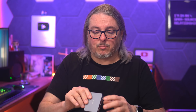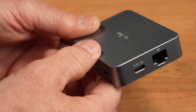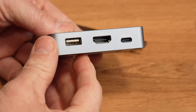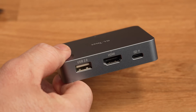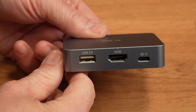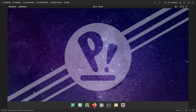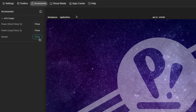Back to this little device. I wish it were PoE — it's not. That's the one spot I think they missed, but in the sub-$100 category it's hard to find any that are PoE. We do have standard USB power, one standard RJ45 connector, HDMI in, a dedicated port for keyboard/video/mouse, and what is labeled as a USB 2.0 port. This is where we connect USB 2.0 over to the ATX adapter, and it shows up in the UI. Hardware-wise, a pretty clean and simple device.